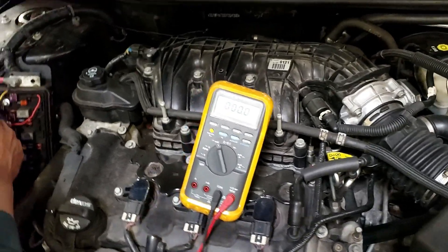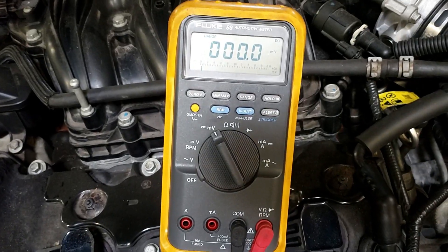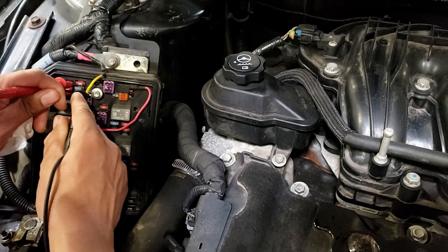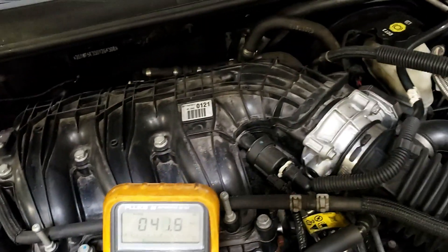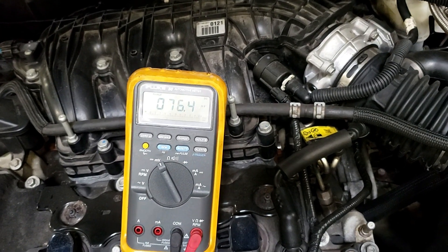How to do parasitic draw with your voltmeter on millivolts DC. Notice we're at zero. He's on a fuse, but take it off the fuse for a minute and show us ghost voltage. So if you got ghost voltage, you see it bouncing around — you're not connected.